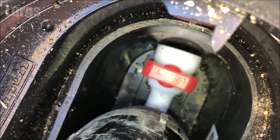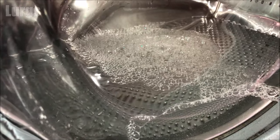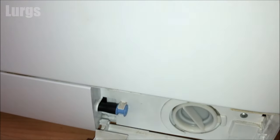If you've still got some excess water inside the drum, carefully open the door and use a sponge to drain this out as much as possible. Now let's check the filter — this is in the bottom right-hand corner. Just pull this flap open.